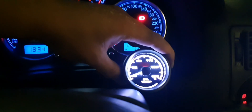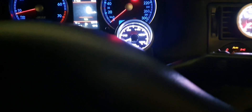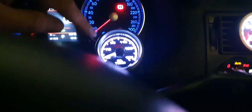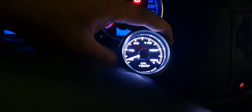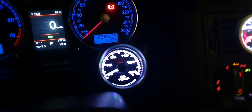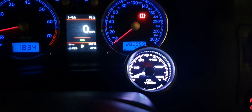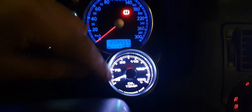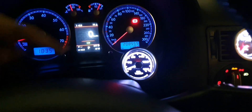Everything's all buttoned up and the gauge is working — it's now going up slowly. The coolant temp is 75 degrees by the gauge, and the oil temperature is slowly but surely rising — it's about 55 degrees at the moment. It'll probably get up to 60 a little bit later, but it is moving up, which is what we want. We want to see the sensor working. I want to track how hot the oil temp gets in this car, especially with the KO4. I'm going to monitor it daily since I'm driving it every day now.